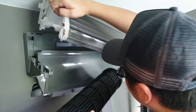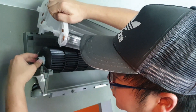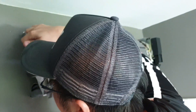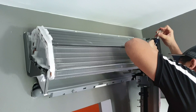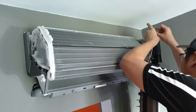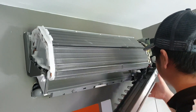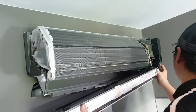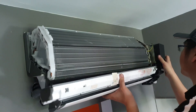The blower goes back the same way — pull it up and put it in. Make sure that the catcher sits nicely in, then click it back down. This will put everything in place. Screw it back — this is harder to access so let's screw this in. Done for this part. Put back the blower and just make sure that the catcher goes in here. Slot it down this way and go in. You may pack up the control board for easier reassembly.